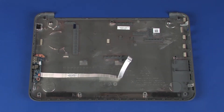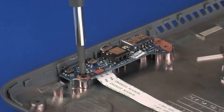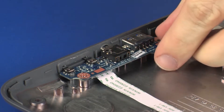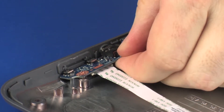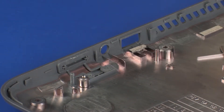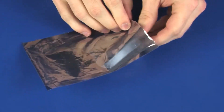Removal. Remove the 3 mm P1 Phillips-head screw that secures the audio USB board to the base enclosure. Lift the right edge of the audio USB board off of the alignment pins and slide the audio USB board external connectors out of the cutouts in the base enclosure. Remove the audio USB board and place it in a static dissipative bag.